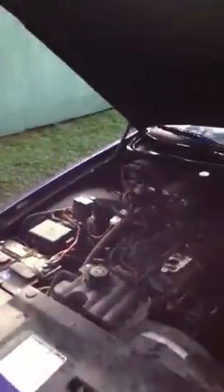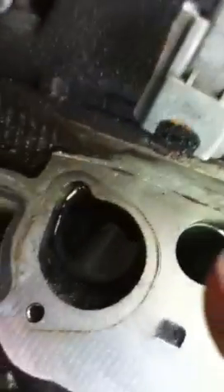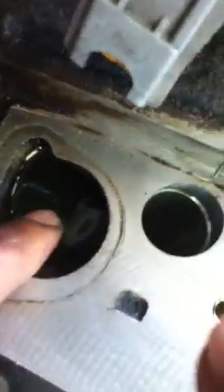Notice all the cylinders were filled with coolant. This is a big thing on these cars. If you've got a 1990 up to about a 2007-2008 Crown Vic or Grand Marquis with the 4.6 liter, they all have these problems. This is probably about the 20th one I've done. You can see right here — look in there — that's number six cylinder, filled with coolant. Over here, that's going to be seven, also filled with coolant.